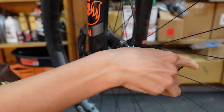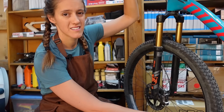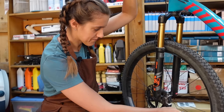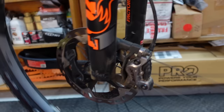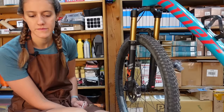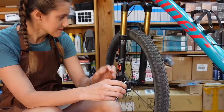This works because you're holding the brake down, so it's already clamped on the rotor — presumably clamped in a centered kind of way. Then you're tightening it there, so when it releases, it releases the same amount in either direction. The idea is that if your brake is working properly, both sides of the caliper are moving evenly. There's a little rub in one spot, which might mean the rotor is not entirely straight. But this is way less resistance. If your brakes are not working properly — like if you have a stuck piston — this won't necessarily work. That'll be a different video. If this works, great, you're good to go. If not, we'll try a different method.